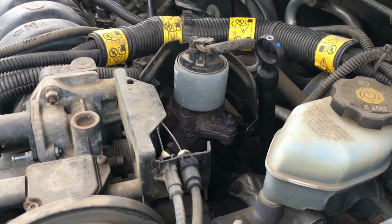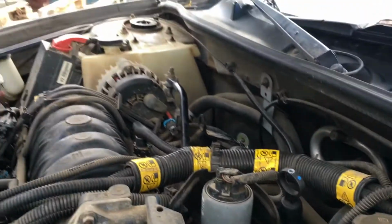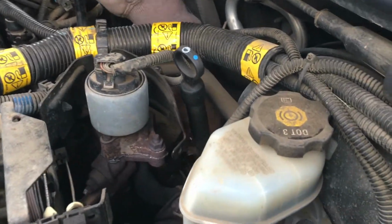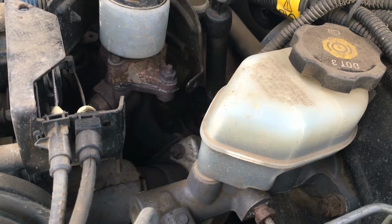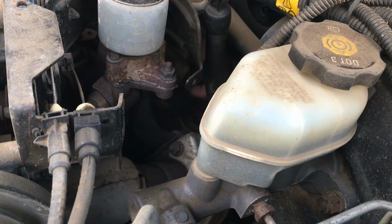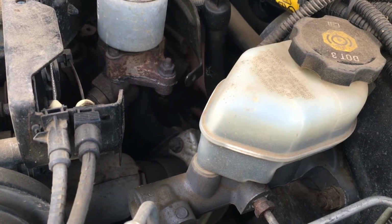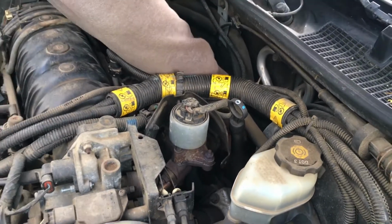over to my 3/8 ratchet. That seems to work the best for it. Just the ratchet itself, no 1/2-inch adapter. So that's all the space I have to get to this plug. And this one I have to pull on it a little bigger because the wrench handle isn't as large, so it's not giving me as much torque multiplication factor. There. So now my plugs are torqued, and that completes getting the plugs changed.